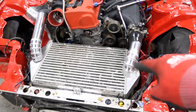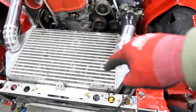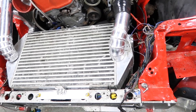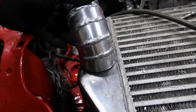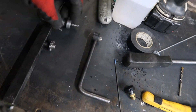Now I need to drill holes in there. I've not got a hole saw big enough, so I'll probably do loads of little holes in a circle, chap it all out, grind it up with a die grinder, and weld them on. That's now welded up nicely. There's now a big hole in the side of it, so that is now going to be held there by the silicone joiner. Nice and neat and looking awesome.